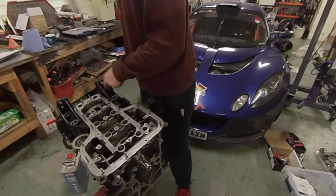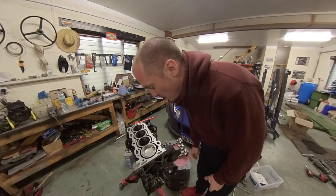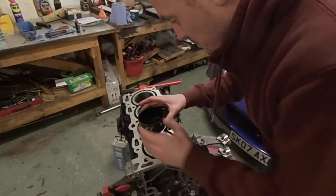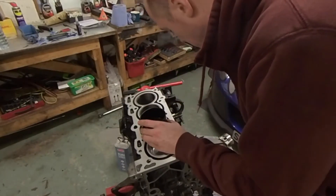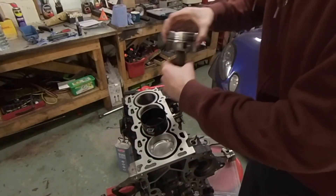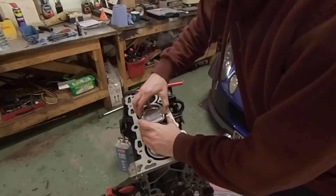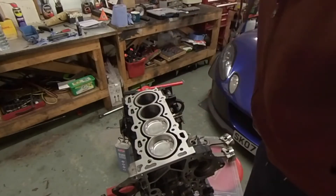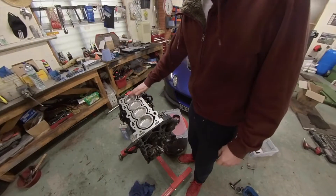There's now a series of smaller bolts that go in all of these holes, which I'll put in place. So I've finished with the bearing cap and the crank — they're in place. Now it's time to put the pistons into the cylinders. This piston ring compressor from Wiseco makes life much easier. Put that on top of the cylinder, take the piston, make sure it's the right orientation, slide it down into the con rod and into the bore. And that is nicely seated. All four pistons are in the cylinders.